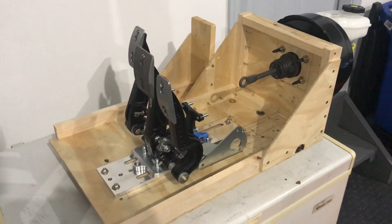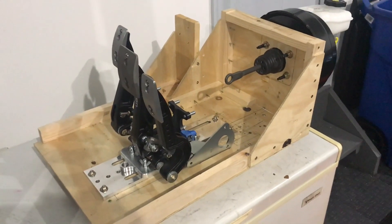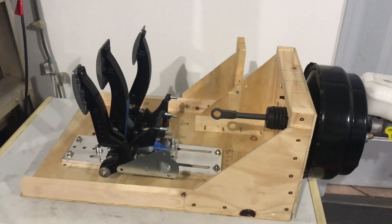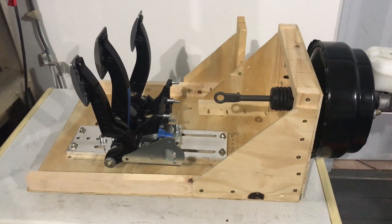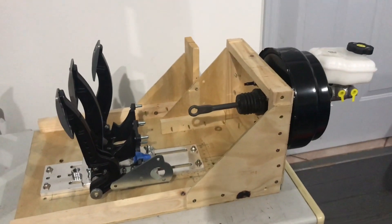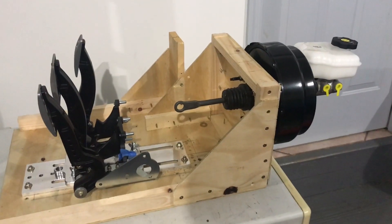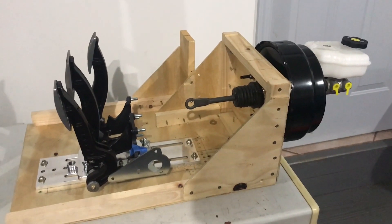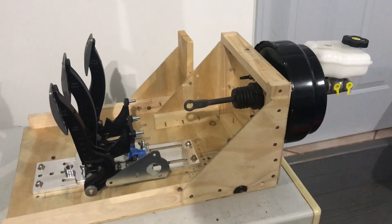Last video I showed the flat plywood piece I used to locate the pedals. I further mocked up that piece to make it dimensionally correct to the front foot box, including the extended driver foot box. The reason I'm doing that is it just makes it easy to visualize where the pedals go and where the brake booster is going to go. I'd rather drill holes in the plywood than in the chassis — if they're not correct, I have a problem. I've actually built this box a couple times already.